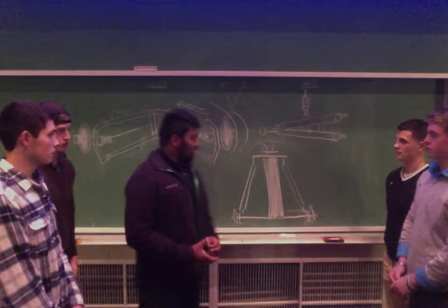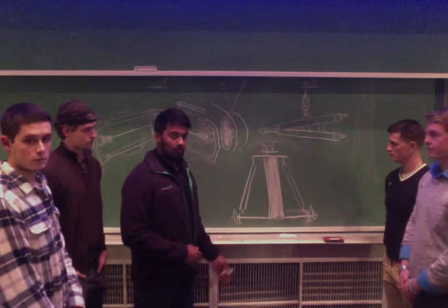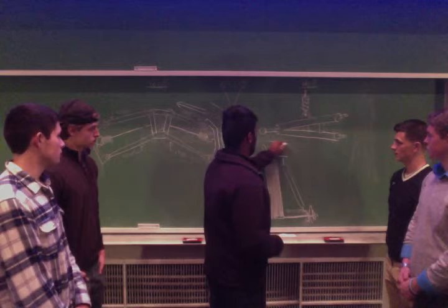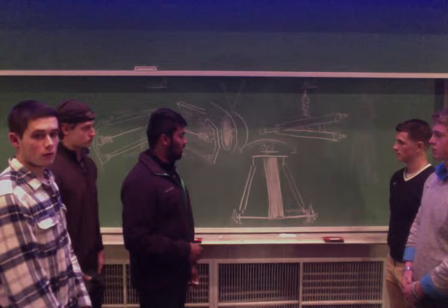This over here is the top view, which is going to allow us to control the toe of the vehicle. During the Mini Baja races, we don't want any toe — neither positive nor negative. The benefit of having this suspension system is that if any component gets damaged in between races, you get easy accessibility to adjusting the toe back to zero. With positive or negative toe, you will be either plowing or shoveling the dirt, which is going to reduce your acceleration and increase additional wear on the tires and other suspension system components.